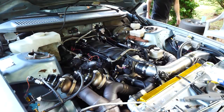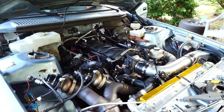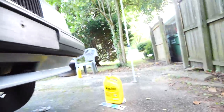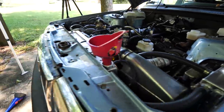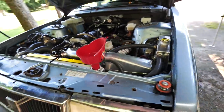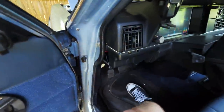I think we're totally done. I'm going to go ahead, prime the fuel system, make sure there's no leaks, then start her up and let her hit operating temp. Everything seems to be in order. The crank pulley is buttery smooth. Fan popped on, everything is good, there aren't any leaks. This fitting is not leaking. It swallowed some coolant so we'll top it off, but I'm going to go ahead and call that a mission success.